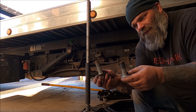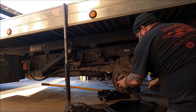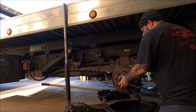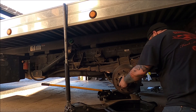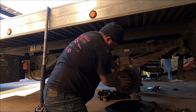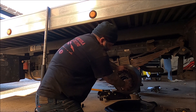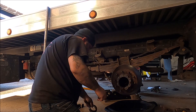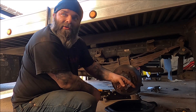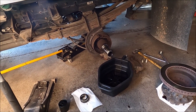That's how big them bolts are right there — that is a three-and-a-quarter-inch big socket that's going to go on here like so. And then all you've got to do is give it a little flip and she comes off. Now you take this nut off — it is keyed, has little teeth on the back side. And then here's our bearing that goes there, and this guy here goes on that race right there. And that's how you remove a brake rotor from a 5500 Dodge Ram tow truck.